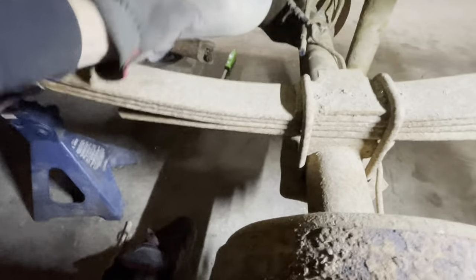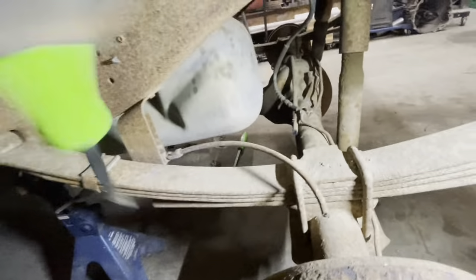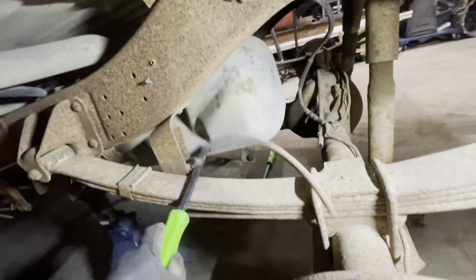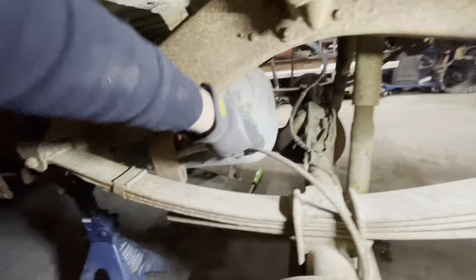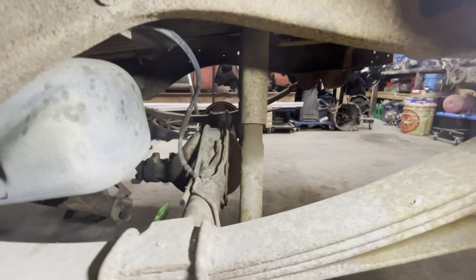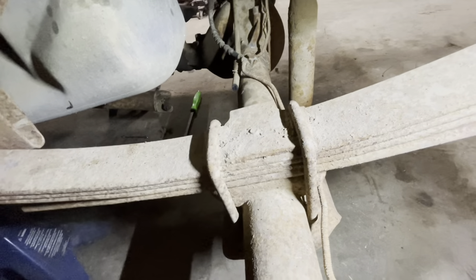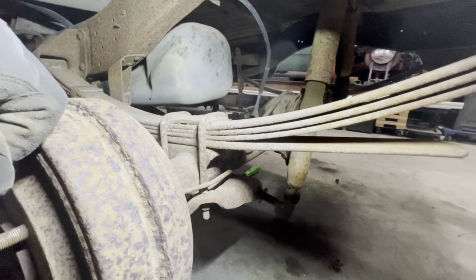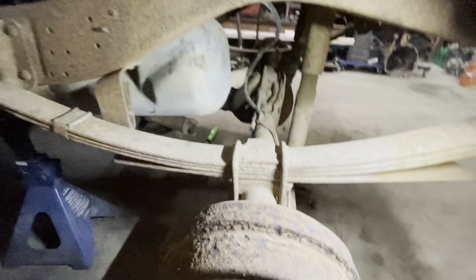That one is a little stuck in there - just magically grab a pry bar here. Just like that, it's out. Now we can - I would remove the shocks completely because once you go to put the rear diff back in it's kind of a pain with them hanging there. Then we're going to remove the u-bolts. If you don't have them you're gonna have to get new ones made anyway. A lot of times I end up just cutting them, but I'll try and impact them off - if they come off cool, but generally I just cut them with the grinder.